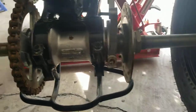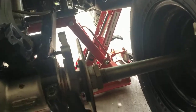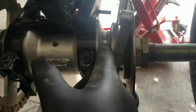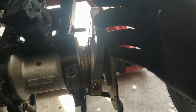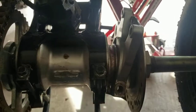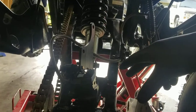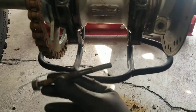I was able to swing out the whole caliper and bracket assembly. There's a — I believe this was a 16 millimeter bolt that went through this bracket. It basically goes into this groove; the bolt goes straight down through this bracket here and it holds onto the rear differential right here. It's got a little aligning tab up here. The reason for removing that is so whenever you move your differential rear axle, you've got more room to move it.